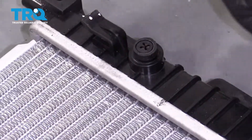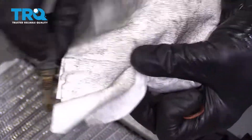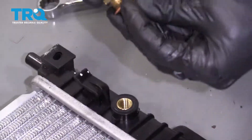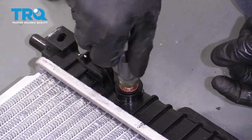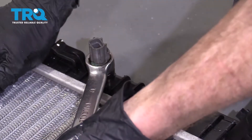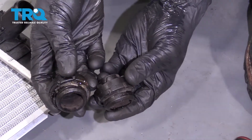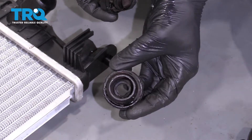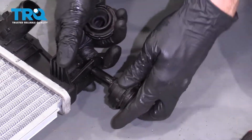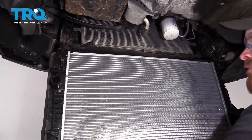Now it's time to put all this stuff back onto our brand new radiator. Remove this plug, clean your sensor, and clean the gasket — if you don't have access to a new one, at least make sure it's in good condition. Start it in by hand and just make sure it's tight, but obviously don't go too tight or you'll break the brand new radiator. For the rubber bushings, notice they have two different sides — have the side with the small hole facing towards the radiator and the other side facing down towards where it's supported.